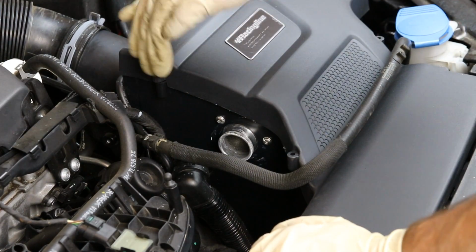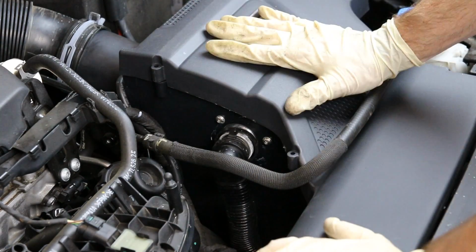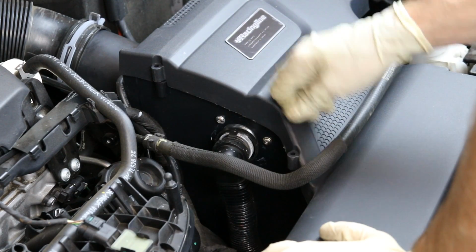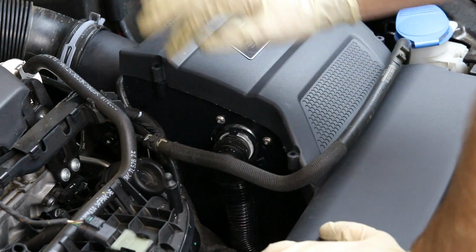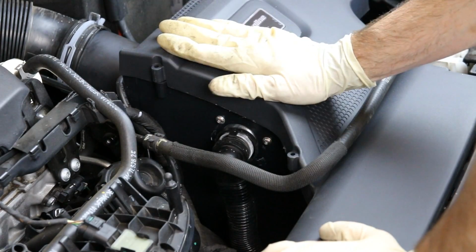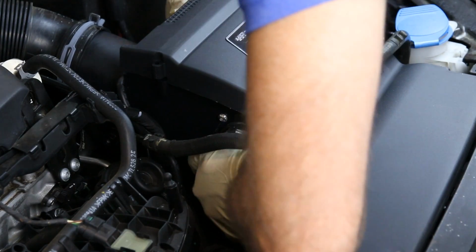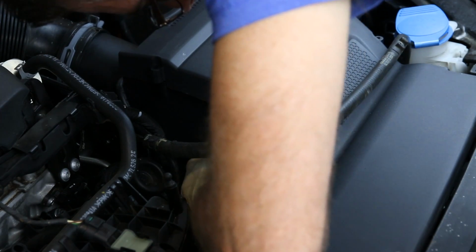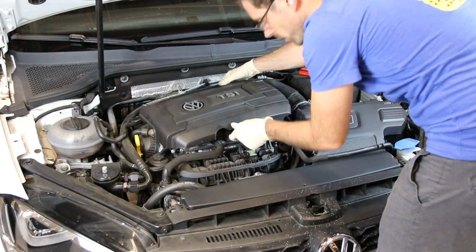Now we're going to get this mounted in place. This is our secondary air intake hose, and all we're going to do is slide that in place. Now, something to keep in mind, this is a GTI, a Golf 1.8T, which uses this same intake, would also have same location of a secondary air hose. If you have a Golf R, your vehicle does not have secondary air, so you would get the other intake, which is a non-secondary air one. We'll put a link to both versions in the description so you can check them out. And to get this mounted in place, all we're going to do is slide that in place, and we should be all set there.